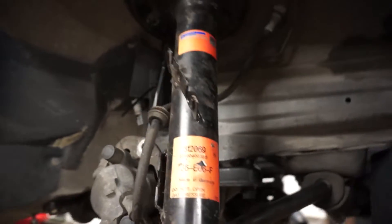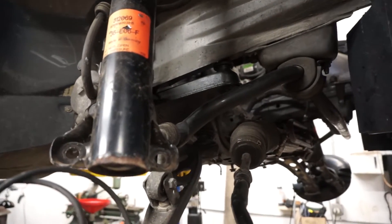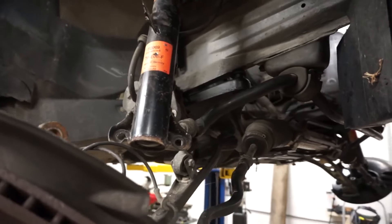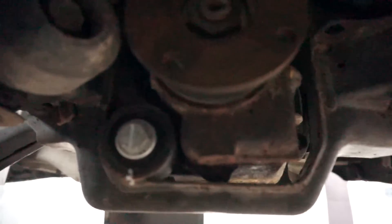The mount on it is on the wrong side — the spring perch is reversed. So somehow I had these installed on his E36; as you can see they do bolt in, but it's definitely wrong. So I have to get another passenger side strut. I have the diff in and torqued down with marks, so you can see it's been torqued.